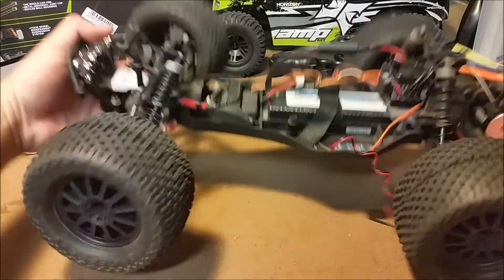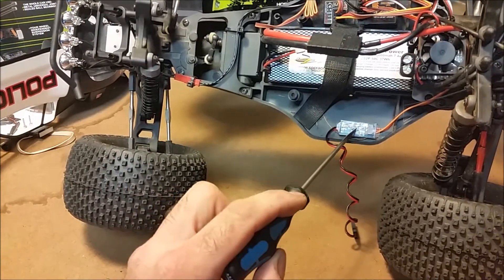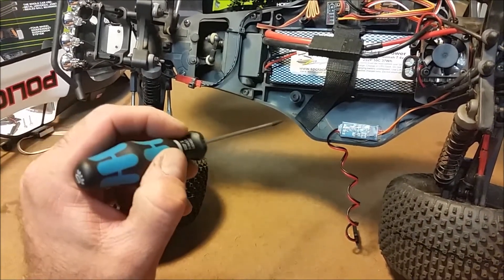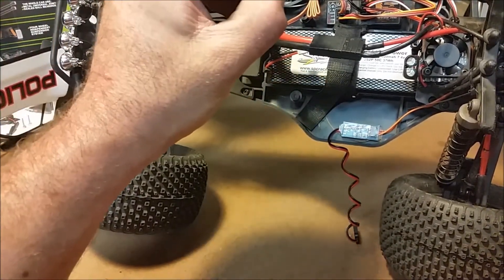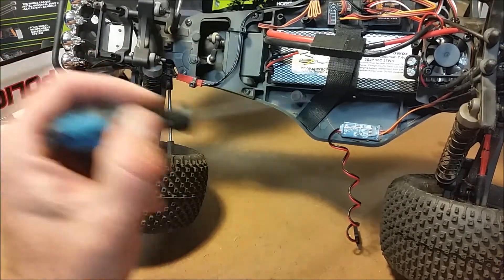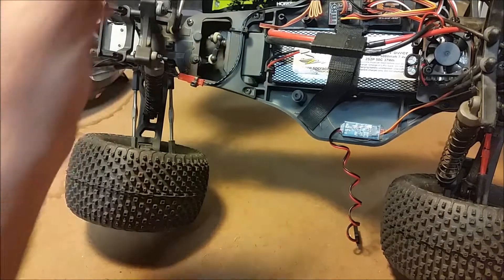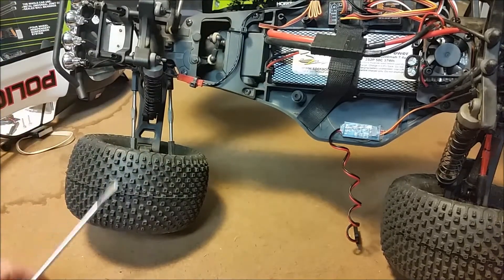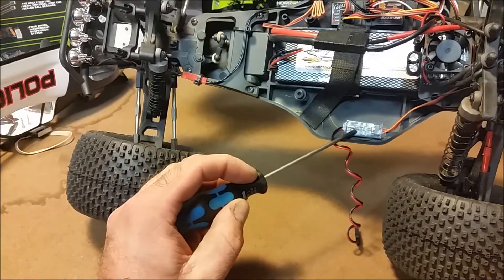The other thing I've done is put the light bar on the roof, and that's a little bit more involved. What we have here is the controller for it — this is a Dr. Mad Thrust on/off switch. I got it from Hobby King and I'll provide the link below. This is wired over to yet another unused port on my receiver. By using the channel 3 port on the receiver, I can use the channel 3 button on my controller and in doing that it turns this on and off.